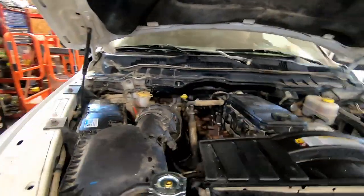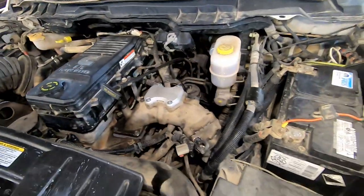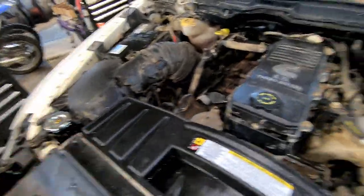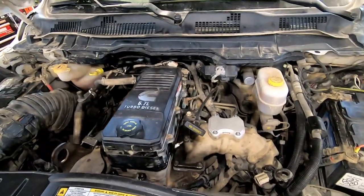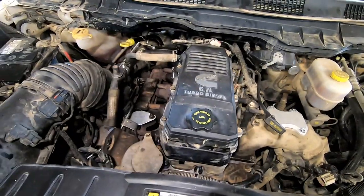Engine started. Once it's running good, check your oil, check your coolant level, and check for leaks — look underneath it. Park it outside, let it idle for a bit, then take it for a drive and bring it up to temperature. Do one final check of all fluids and everything. That concludes my video for head gasket replacement on the 6.7 Cummins. If you're pretty decent with a wrench you should be able to follow along. If you liked the video and found it useful, please like and subscribe. If you have questions, ask in the comments or find me on Instagram at Dark Iron Diesel. Thanks for watching.